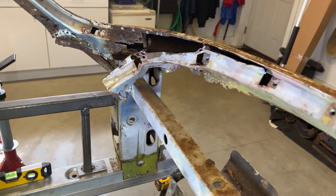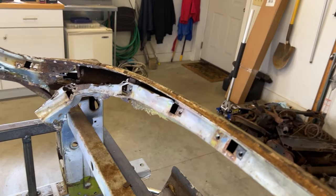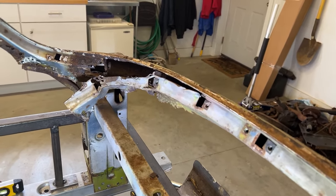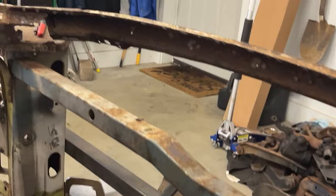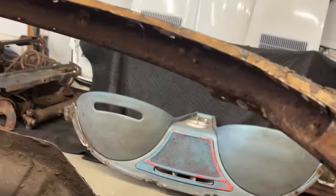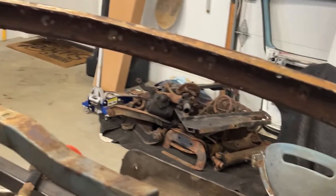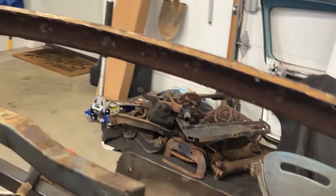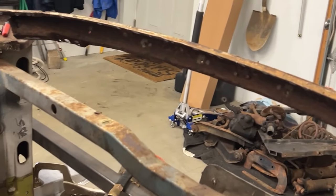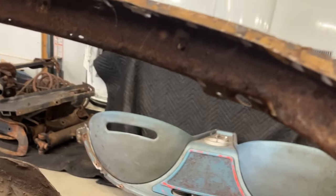As you can see it's a slow process - you've got to cut all those spot welds off. The outside bottom looks really solid; it's just this thinner piece that I've ordered and I'm going to replace. It's coming off pretty nicely. I worked most of the afternoon yesterday and got the inner lower window frame removed. Even though you see a lot of surface rust on the outer one, the thing is very solid - I'll sandblast that before I put the new one back in.